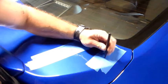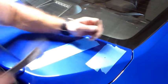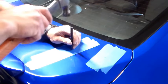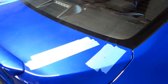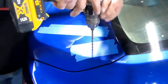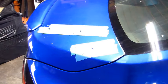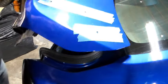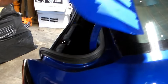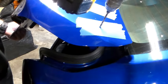I like to use a punch to leave a small dimple to start my drill bit so it doesn't walk on me — just a tiny dimple, you don't need to cave your trunk in. Your first hole is going to be with a 7/64ths bit; a 3/16ths bit will also work fine. Make sure the trunk is open when you do the outer holes, otherwise you could hit the weatherstripping and mar it up. Drill all the way through and keep your bits straight.